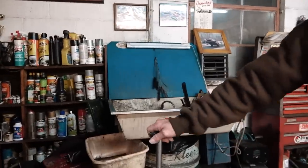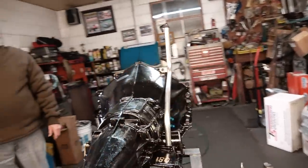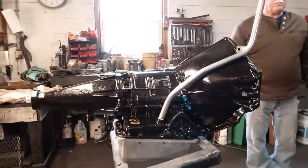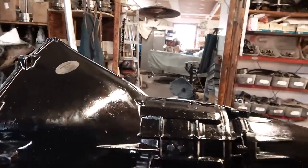That should hold a thousand horsepower — we might teeter on the edge of a little bit more, but we'll cross that bridge when we get there. The stock case should be fine unless something's not lined up or flexing. He put a locking dipstick in it. The valve body has no markings, no initials, no part number — the separator plate normally does but this one's got nothing. So we've got an unknown valve body, which matches the weird stuff with the drilled holes. The solenoid is definitely ATI, but not the normal one.